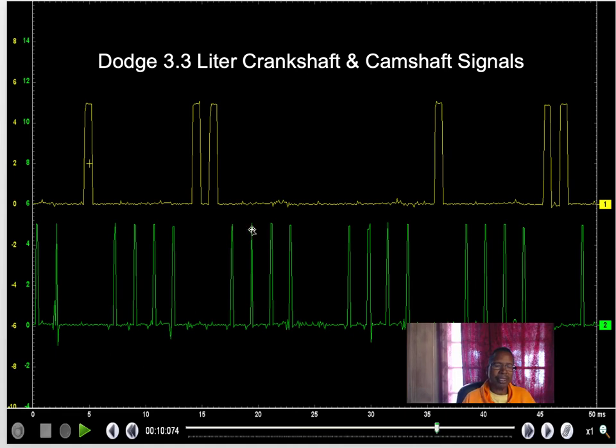For example, you notice how each of the cam signal slots, which represents a certain position inside the cam sensor itself, falls right in between every 4 slots, like so. It falls right in between the crank. Oh yeah, I forgot to tell you, this is a crank signal. These 4 pulses from the crank are the RPM input to the PCM. These four symbols represent the RPM signal on crank position. Crank position is for RPM, and the cam is engine position for finding the coils. That's your cam sensor, and you noticed these fall right in between each individual 4 signals. This is how it's synchronized.